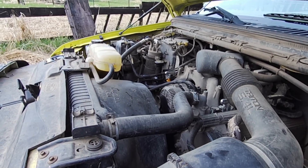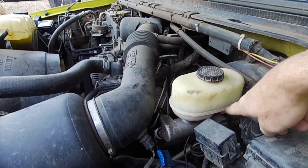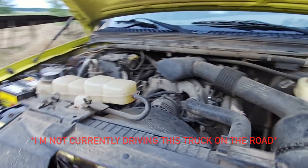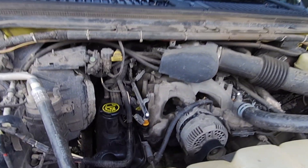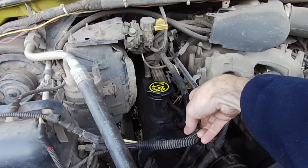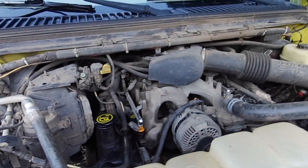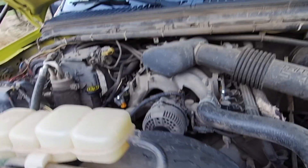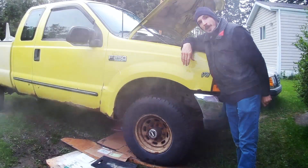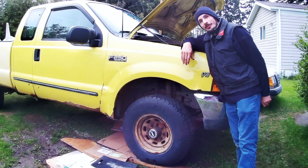While you're under your hood changing your oil, it's a great time to check for other problems. Right here you can see my brake fluid's down to the minimum — I'm going to be flushing this soon anyway, but you'd want to top that up. Check for leaks, loose wires, and worn-through hoses — things vibrate and wires and hoses rub on stuff and wear. So that's the time to check for all that sort of thing while you're under there changing the oil. So there you go guys, that's all there is to changing the oil in your 5.4-powered Ford Super Duty. Hope you found the video helpful — don't forget to like and subscribe, and have yourself a great day.